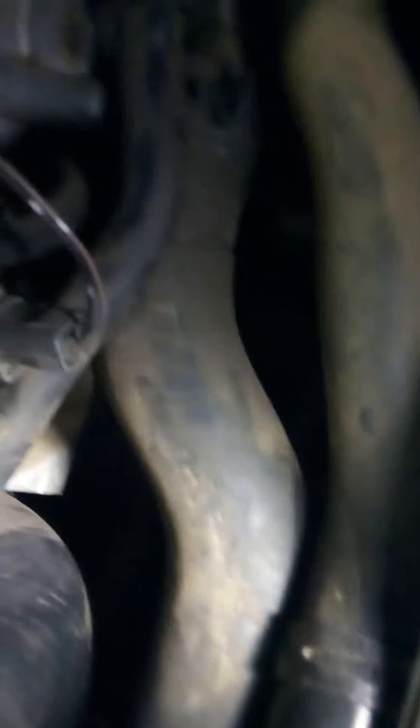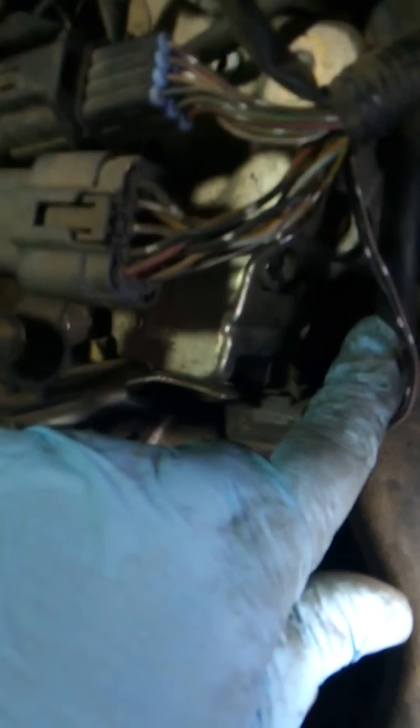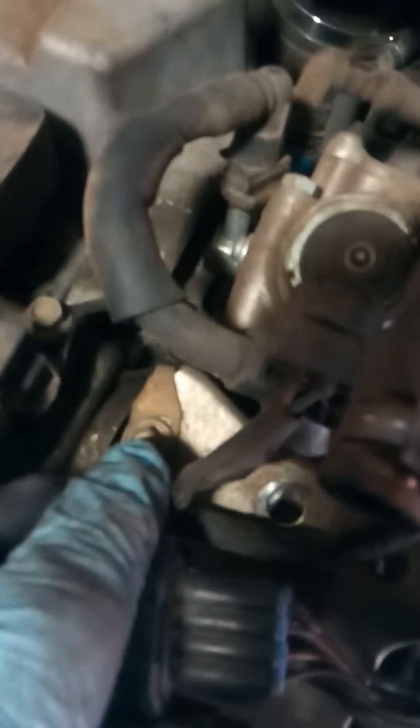At this big yellow metal bracket, there's a little 8mm bolt right at the top, and right behind this little hose there's another 8mm bolt — can't really see where it goes but it's right there. There's a 10mm one right above it but that's not the one you want. Just those two 8mm bolts, top and bottom, is all you need to get it loose.